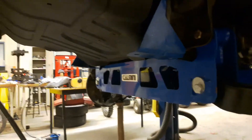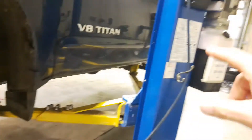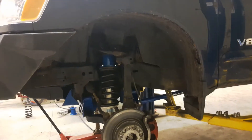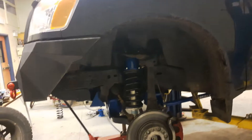But before I do that, I ran into another issue. After everything was installed — everything is 5 inches — the back works out great, the rear end of the truck works out great. But the problem is I am a full inch taller in the front than I am in the rear, whereas before the lift I had a full inch and a half more height in the rear than in the front.